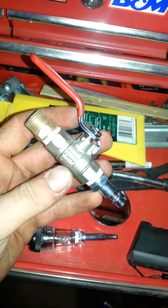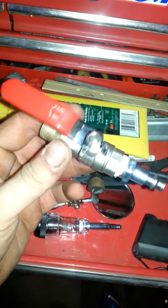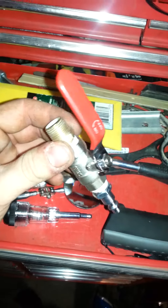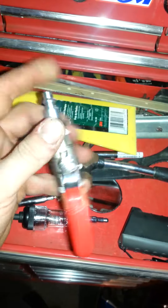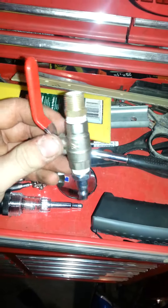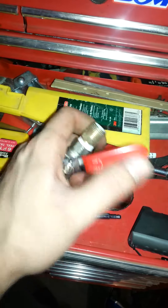There's a dental mirror, a spark plug tester, and a tool I use for blowing out heater cores. It's a 3/8 ball valve with a 3/8 to quarter-inch adapter for an air hose and a double male fitting that fits perfectly inside heater hoses. I work mainly on GM stuff and this fits the heater hose perfectly. You can control the airflow throttle - you can't just full bore it or it'll blow the hose off and make a mess, but it's a better method than using channel locks with fuel line over the jaws.